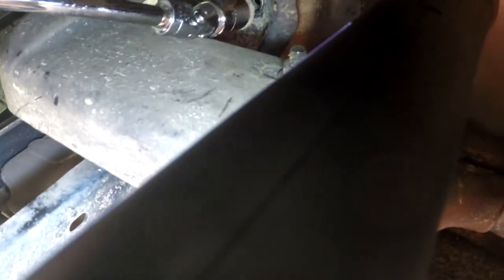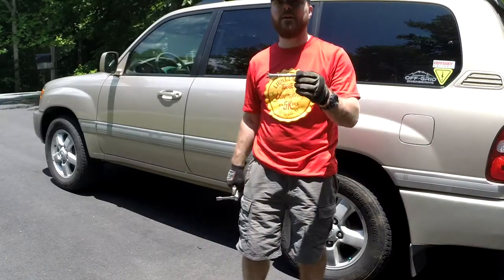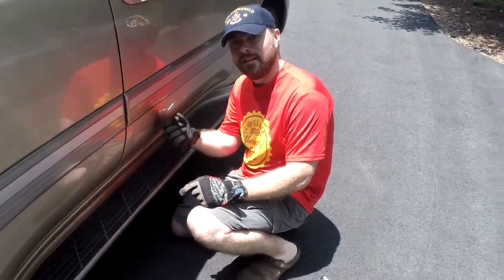That one you can see I can get it on there and I just have a little bit of bend in the universal joint so it comes right out nice and easy. Pretty much all of them besides those couple challenging ones are easy to access with any standard ratchet. I ended up also needing a 10 millimeter open-end wrench for the little mount up front.